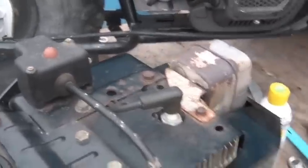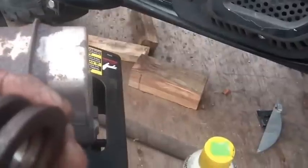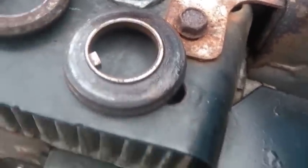This engine only has one shaft, which is good. They put the keyway right integrated in with the pulleys. Check out the little pulley for driving the belt — it's two pieces, you just smash it together and it smashes up against this collar, then you put the bolt in and it holds it all tight. These are keyed also, as you can see — one key, two key. So that's the pulley assembly.